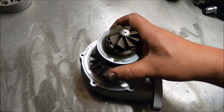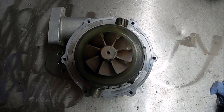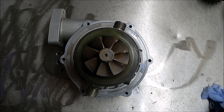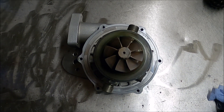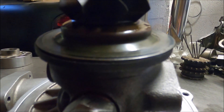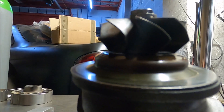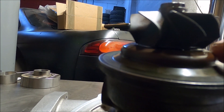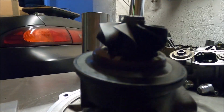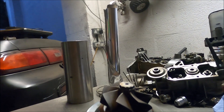From the top at least, it looks very similar to a typical Subaru RHF55 turbo wheel — it's just a good IHI turbo wheel. But this is where it gets weird. I've never seen one with a design quite like this. It goes tiny, then big, then tiny again. Usually you've got an inducer which is much bigger and it curves out to the smaller exducer. This goes tiny, then out, then in. In, out, in. I have never, ever seen that.